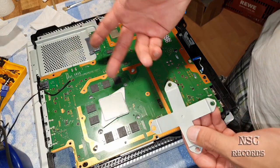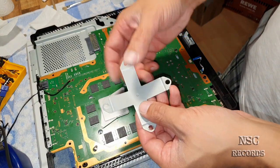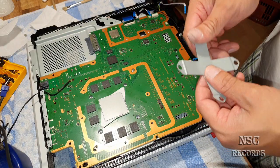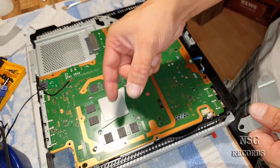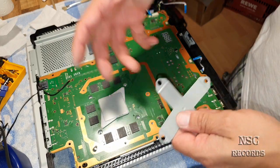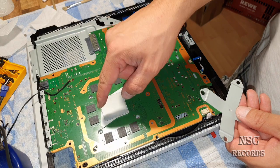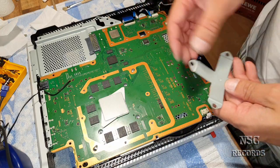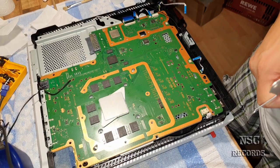In this case here, not. You know why? Because we got here liquid metal thermal paste. Of course, it needs the pressure, but not that much as with Thermal Grizzly Kryonaut. Because this thermal paste from Kryonaut or from Cooler Master, the MasterGel Maker, they are very hard, and of course you're gonna need more pressure because this thermal paste is hard, okay? But in this case here, we got liquid metal, and this thermal paste is just like water. You don't need a lot of pressure, so you could bend it out of the bag, but I don't care right now.